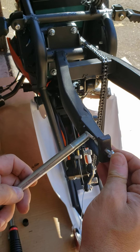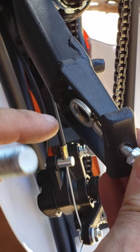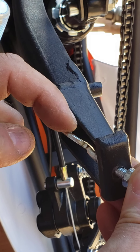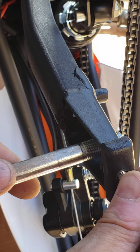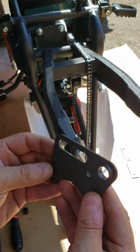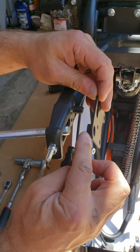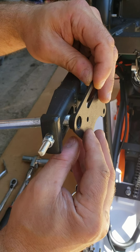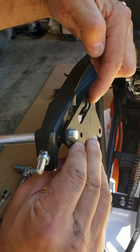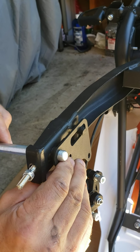Start from this side, so the rear axle bolt has to go through this tensioner first. This tensioner is not perfectly flat, so this side has to go to the fork. Now you have this bracket right here and you're going to install it with a small spacer to the fork.